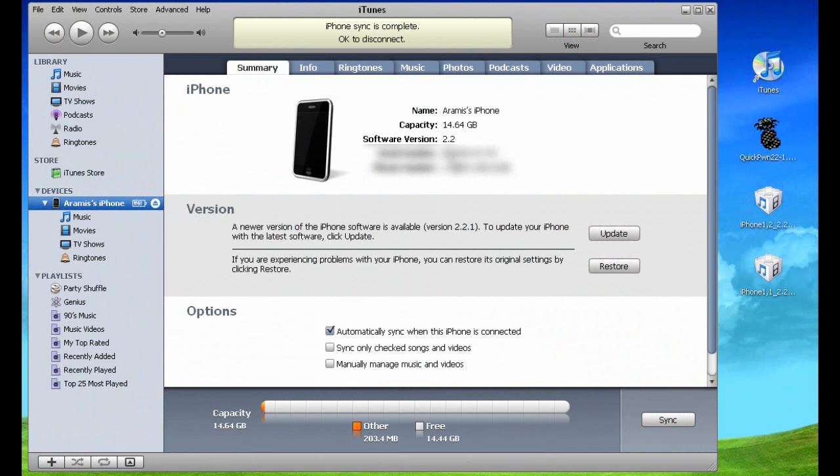Now I have version 2.2 on the iPhone, and if you go into iTunes you will also see version 2.2 there — the iPhone has been successfully downgraded. You can also downgrade to version 2.1 by getting that firmware from aramistech.com. I had several issues with version 2.2.1 including crashes and battery problems, so this downgrade was necessary. If you're going to jailbreak the phone, remember it voids your warranty. If you only needed QuickPwn to reactivate, just close out the program after that one step. Thank you for watching.